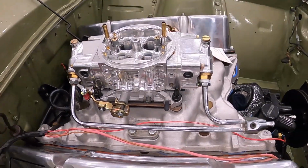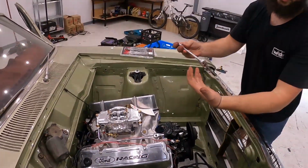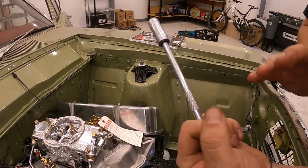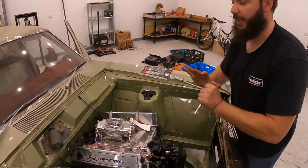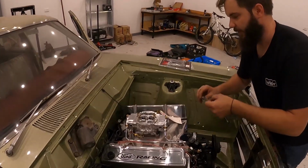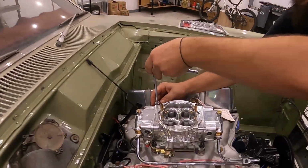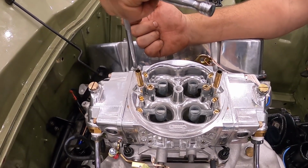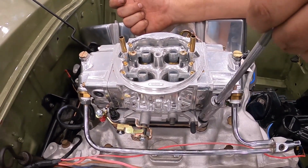That's it, guys. Did you see that? Beautiful. So a bit of a tip, guys, actually hold it. Don't go out here, you'll get too much torque on it. Hold it nice and close, because most men are pretty strong. You would, without even trying, put about 25 pounds of force on. So what you do, guys, very carefully, just a light, small 1/4 inch drive, just, that's it. That's tight. Don't go any tighter, guys. That's it. That's the bottom.